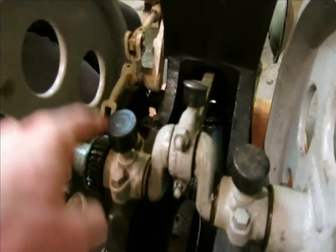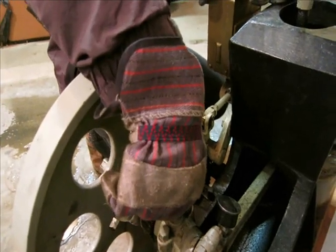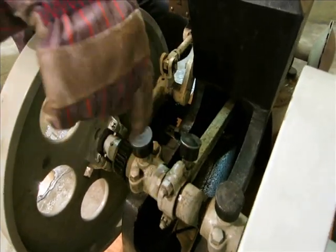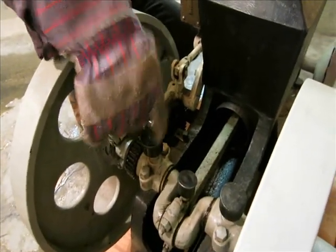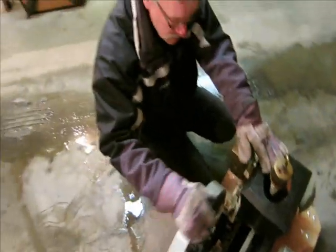And these are all oil? Grease. Grease holders? Yeah, grease cups. They hold grease. You can take the top of the cup off and then you fill it with grease and you screw the cup back on, and the tighter you screw it, it forces grease into the... Yeah. A grease fitting or a grease nipple is the same idea. With those you need a grease gun to do it. These are just built in, that's all. What's the displacement of this engine?